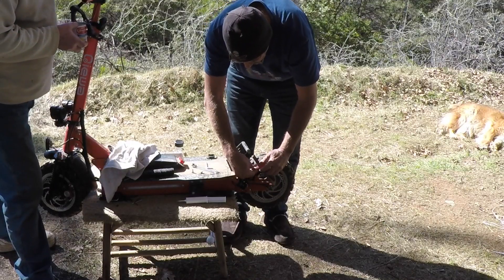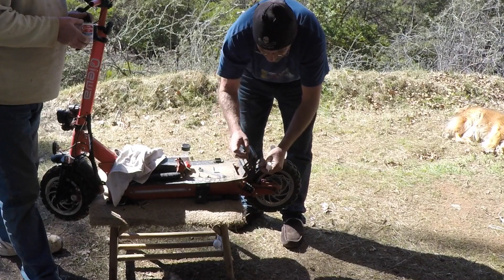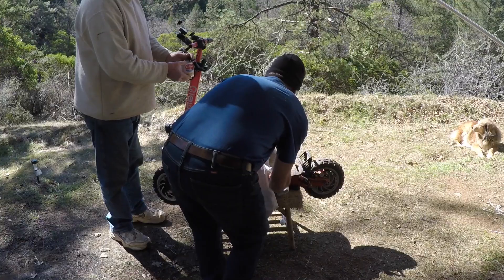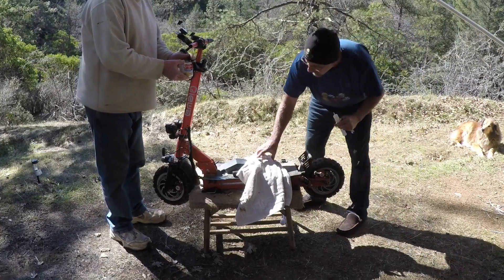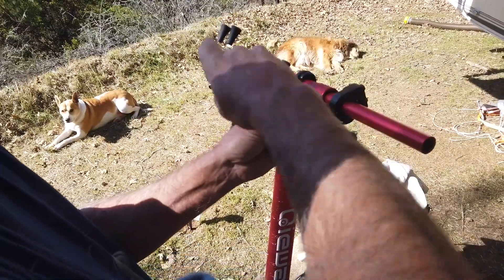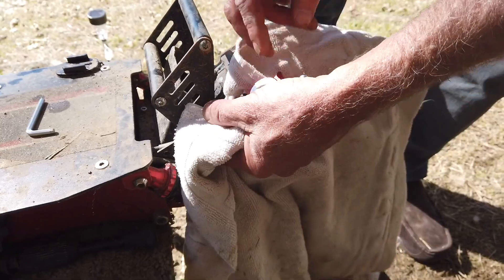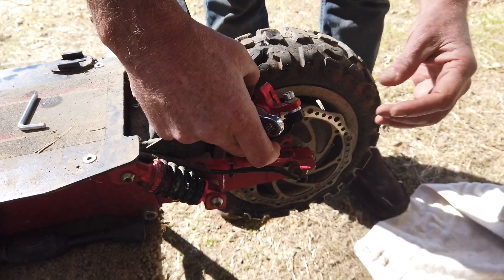You can spin off the brake assembly. Now injecting the fluid from the bottom up. I just put a little squirt of fluid into the reservoir and now I'll attach the handle to the hose. Both ends are attached and tight. I believe bubbles — of course in a hydraulic system any bubble stops the action because you can compress air.